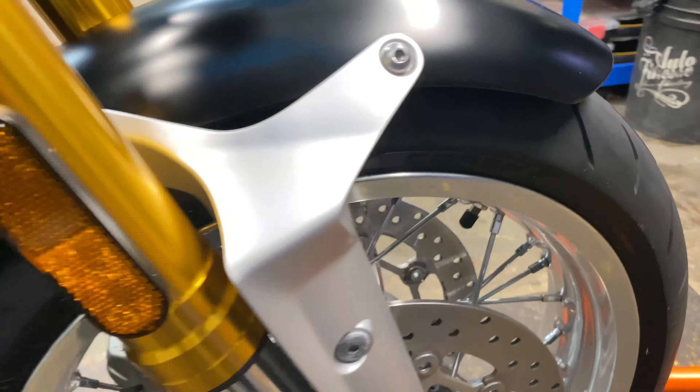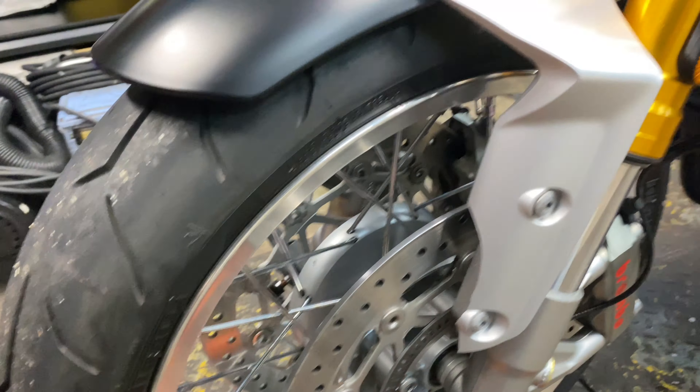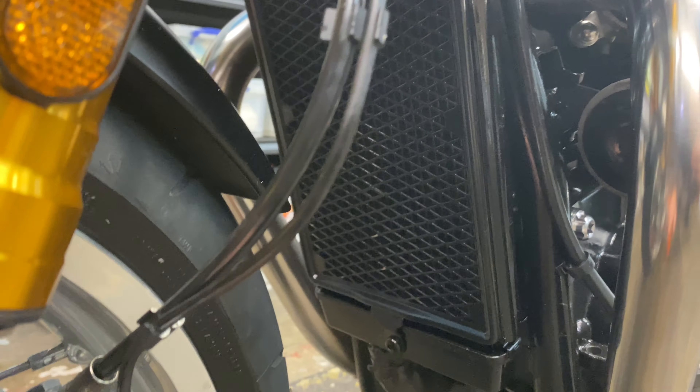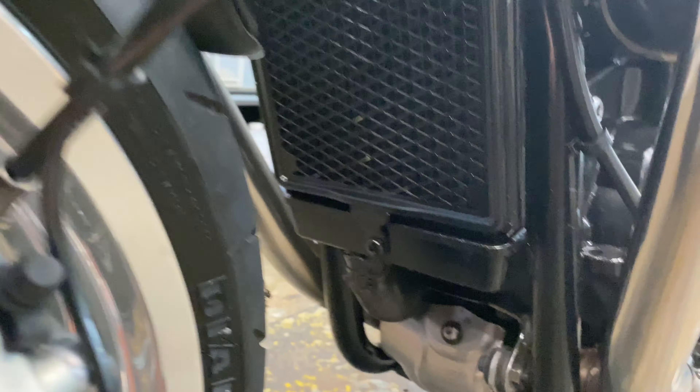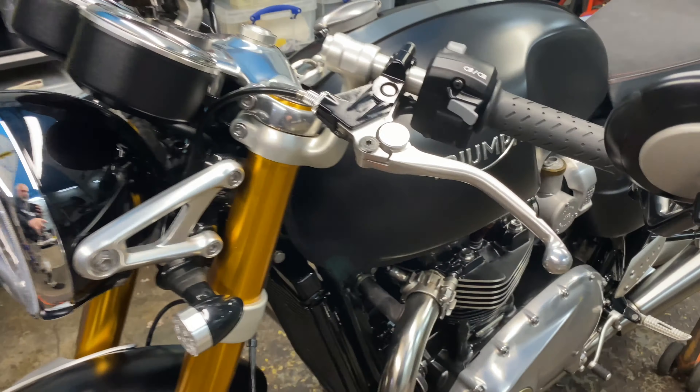All these spokes were just starting to go rusty, so we've given them a good coating of ACF 50 which should neutralize any rust and prevent any further corrosion. I put a bit of paint on that front screen — it had some crap on it. All the bottom there has been cleaned up, I got the sticker off the headlight.